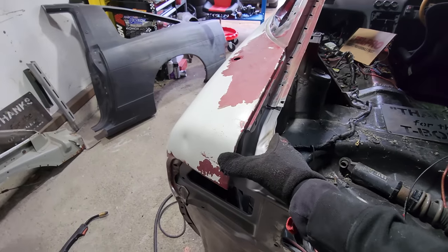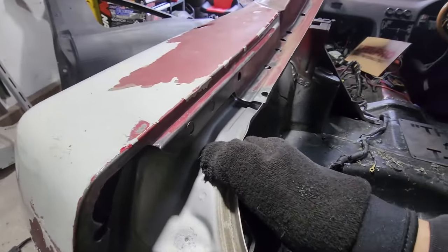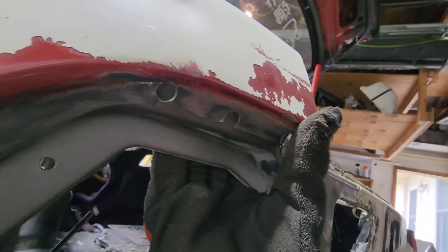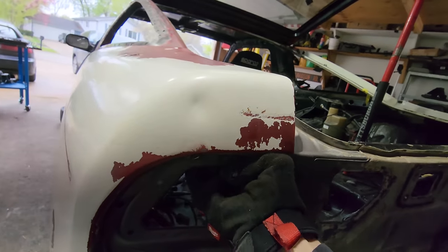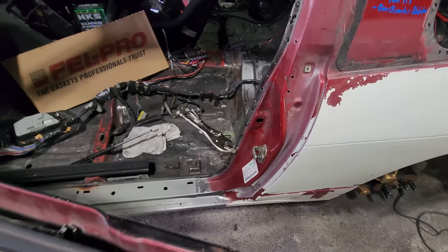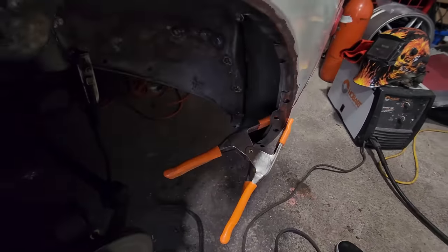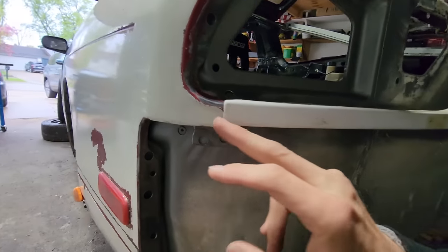The hardest part about this is going to be trying to clamp this down while aligning the trunk, because this back plate has so much play in it. The quarter panel needs to be flush with this back plate, and I'm not going to be able to clamp it here because the trunk is going to be closed. I ended up putting a few clamps on — one here and one there with a big bag clip. I also put on the tail light filler so I can make sure I get this correct, which I'm glad I did because it is very off how it sits right now.